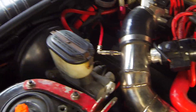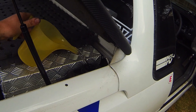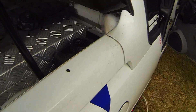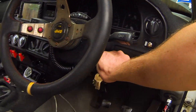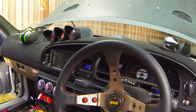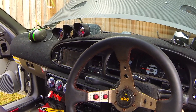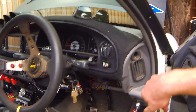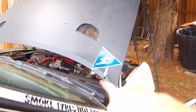I'm now just going to fill up the tank — it's reasonably full. So now I'll go inside and when I turn the ignition, that red light should stay off. Yep, just my air compressor — so that's a good sign. Third and final step, I'll jump the lead to start the pump, and then hopefully we get flow out the pipe in the engine bay.